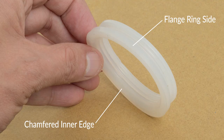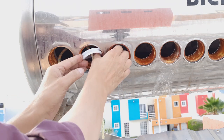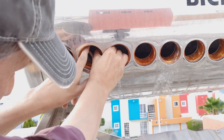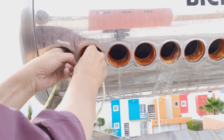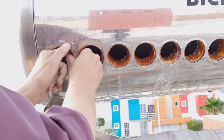The rings have a chamfered inner edge on the side facing outwards where the glass tube will be inserted. One side of the seal ring has a flange type edge which needs to be seated between the foam insulation and the inner metal tank. It can be tricky trying to insert the seal's flange edge in this limited space. Should the seal fall inside the tank during installation, it will be easy to retrieve as I have this nylon rope in place. I start at the bottom side of the ring and work my way around bit by bit inserting the seal flange into the gap. Once inserted, double check and compress any edge that hasn't seated properly.